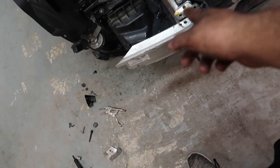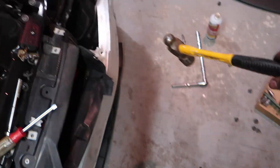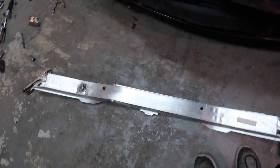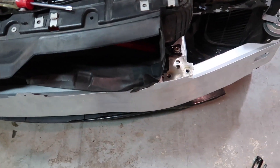Moving the dented bumper — took out the screws, this one was stuck so I had to use PB Blaster, then you just smack it with a hammer. Give it a smack and there you go, bumper's out. Now I'm having issues fitting this on properly, so I got the good old board and a rubber hammer. I literally just kicked it. That one's more stuck so I'll have to hammer it — we'll see if we can get that on.